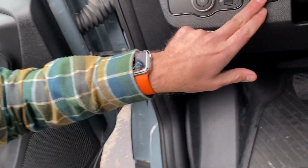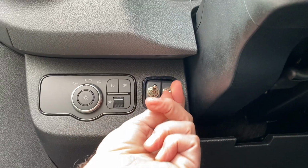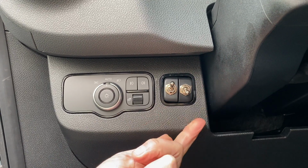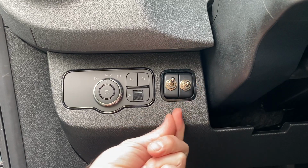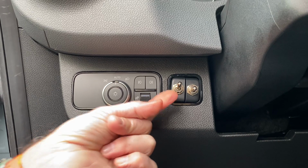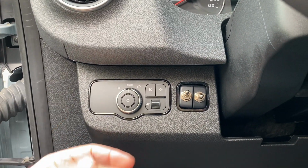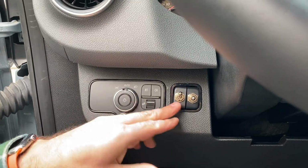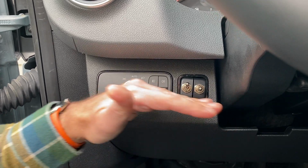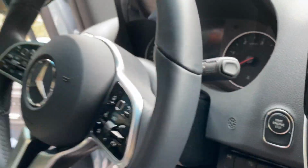And basically the way these switches work, I'm sorry, this is a three-way switch, the one on the right. This is high beam for the LP6s, that's low beam for the LP6s, and this is off for the LP6s. This switch here is basically turning on and off the little small lights behind, which are kind of like a daylight running light or whatnot. So they just look cool. I leave that typically up all the time, leave the LP6s in the off position, and then I control those from here, which is the 6-shooter.